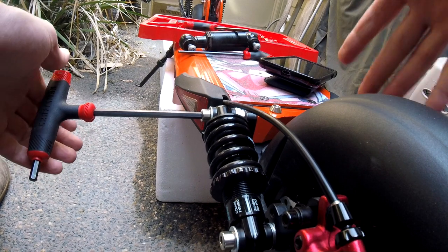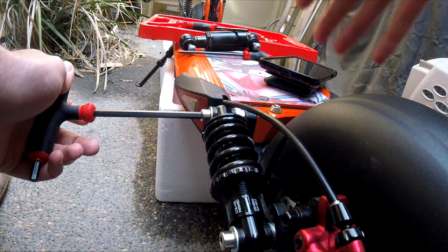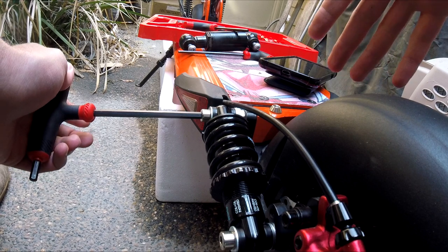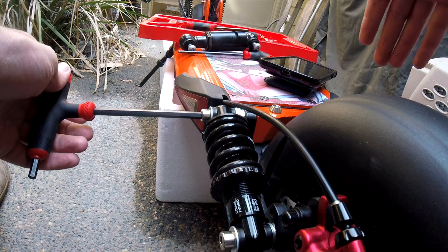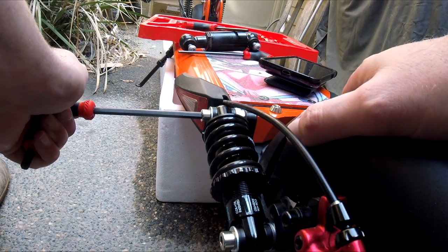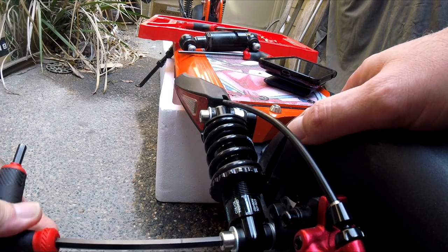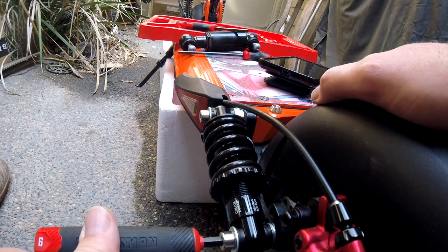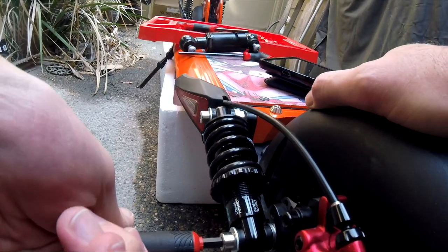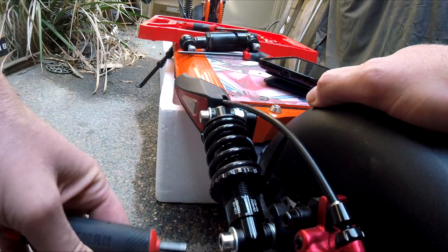This one. One of the things that you're going to need to do is pick up some quarter inch or number 8 washers. I got 20 of them, and I actually ended up using all 20 of them. So for this, like I said, taking them off was pretty easy, and there's freaking mosquitoes everywhere, which are tearing me up. And I would suggest after your first couple rides to definitely check and retighten these down.